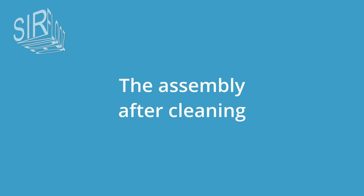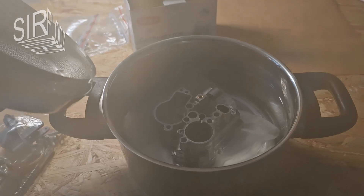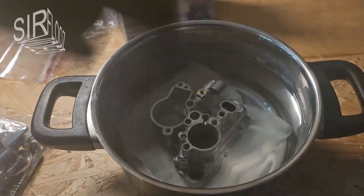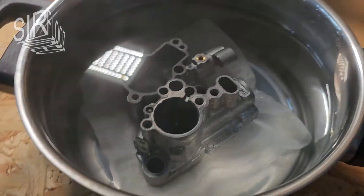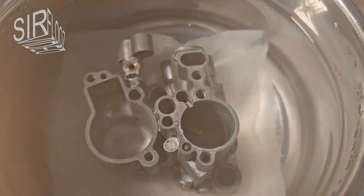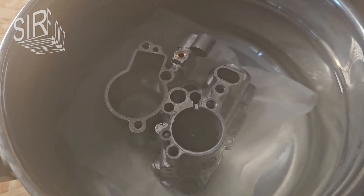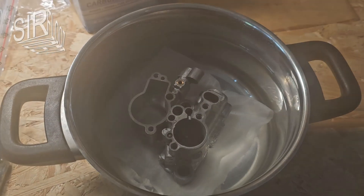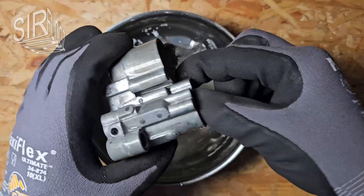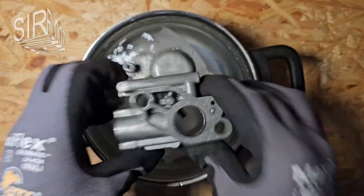How is the carburetor assembled? After my carburetor clogged, I needed to clear it somehow. Without an ultrasonic bath or compressed air, I needed an alternative. I disassembled the carburetor and boiled it in demineralized water for an hour. I hope this dissolved the jelly-like residue in the passage to the idle jet. Then let's test whether the passages between the float chamber and the main jet, and from there to the idle jet bore, are clear again.